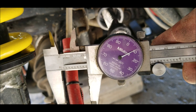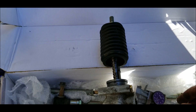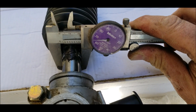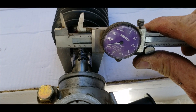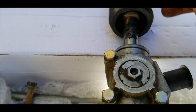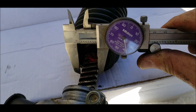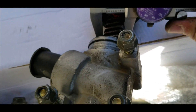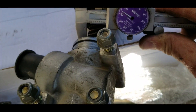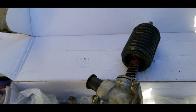The shaft on the factory 570 rack is right at 900 thousandths in shaft diameter. On the 1,000, measuring the gear, it's actually about 864, so it is slightly smaller diameter. Measuring again, we're at about 870 — it could be off just a little bit — so you're at the same diameter or a little bigger on the 570 than on the 1,000.